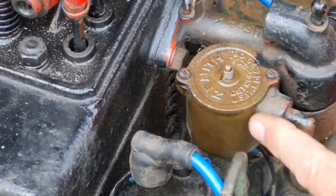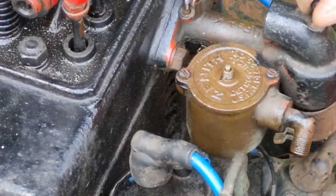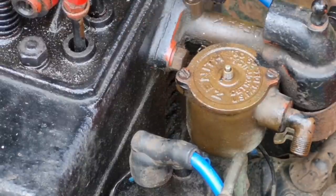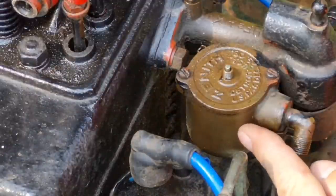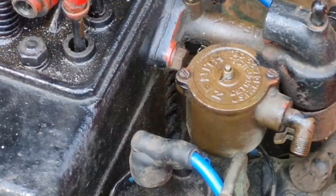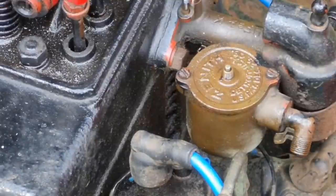Very crude, that overflow. I basically just go into the float bowl, look. Here, I think, is our choke. Right. So, I think I'm going to say our fuel system's all right. I'm not going to upset all this at the minute, because the guy did say that ran last time he had it out. Although, that was a lot of years ago. This bit is just the venturi and the air inlet and the manifold. I'm sure this and the throttle flap is absolutely fine.